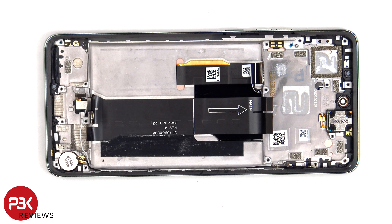The opening on the frame on the bottom for the speaker assembly, as well as the openings for the microphones, all have rubber gaskets and mesh filters. For those who are worried about puncturing or damaging the microphone or filter, both on the bottom and top, you won't need to worry since both the filter and the microphone are seated above the holes, so they won't be damaged.